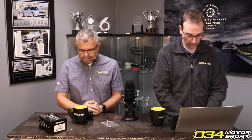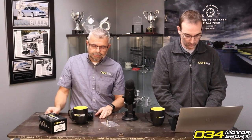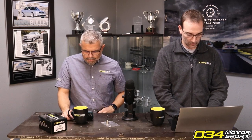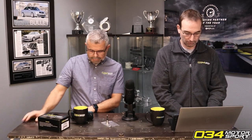The additional power on the 2.9T One Plus is impressive. We are not doing a Stage 2 for the 2.9T — as we've discussed, we just did not see any power gains with aftermarket racing cats on that application, so why release a file if there's no benefit? The factory cats in the 2.9T — there are two separate cats and they flow quite a bit — they flow as much as the stock turbos could produce on Stage 1. Feel free to follow up with any additional questions, but they are for sale and they are selling.